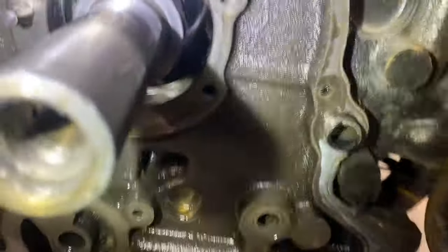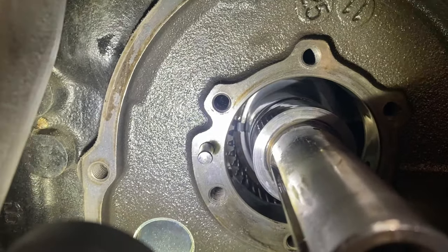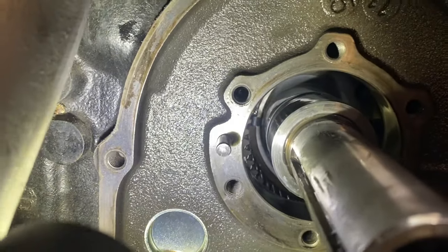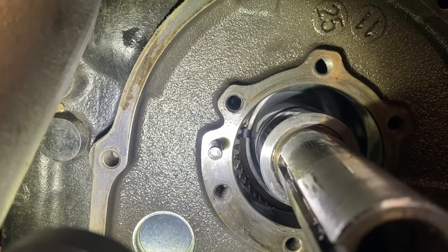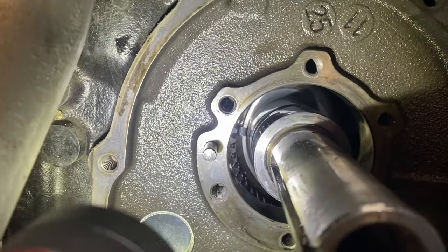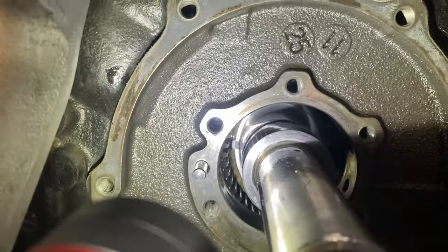In here — let me get the light down so you can see — that's the rotor in there. It has a keyway for the bearing as well as the bearing itself. There are no heat marks or anything on the bearing, and that bearing is still keyed into the rotor exactly as I originally installed it. The bearing hasn't moved on that rotor either — no material, nothing in there that would speak otherwise. This lets me inspect half the bearings. To see the other half I'd have to take the transmission off, and I'm not going to do that — there's no point at this time.